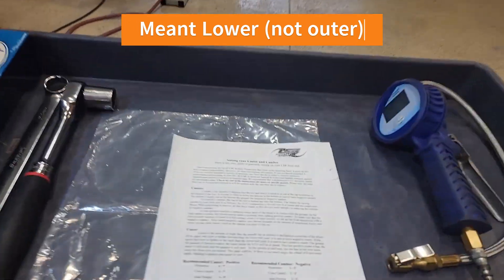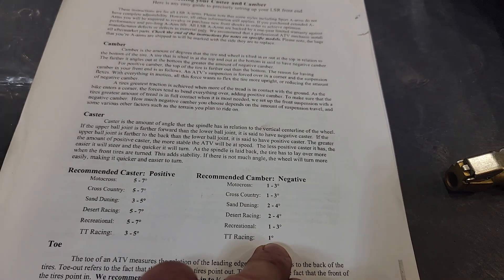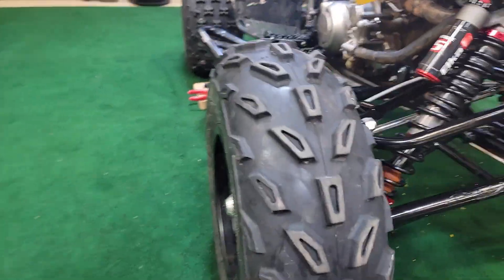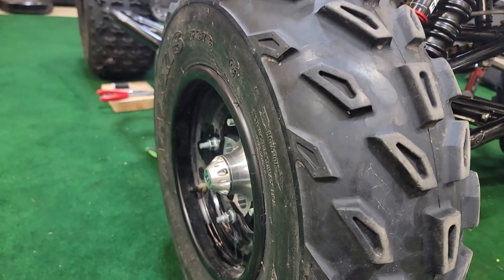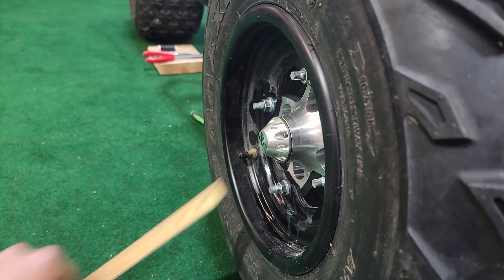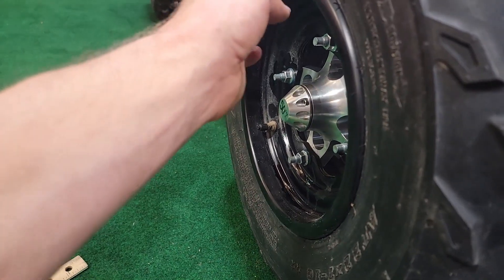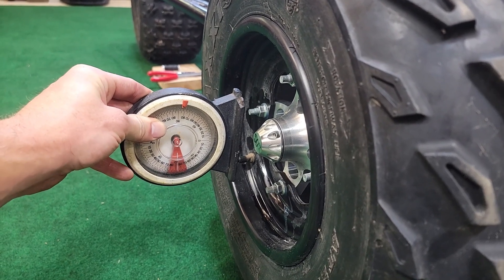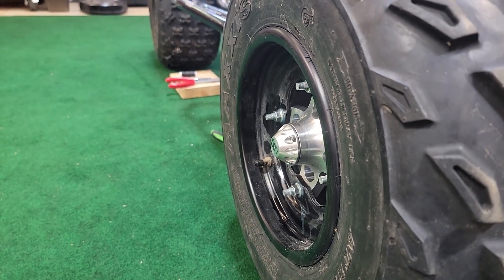Going back to the chart, for motocross we want one to three degrees of negative camber. With negative camber, the top part of the wheel is going to be tilted in slightly with respect to the lower part of the wheel. The way to measure that is to take some sort of flat edge seated on the wheel. You can use it on the tire, but the tire does slightly balloon on the bottom, so just make sure it's equidistant from the upper and lower part of the wheel. Then you put that angle finder on there and it should be tilted in just a little bit. That same app on the phone works really quite well as well.